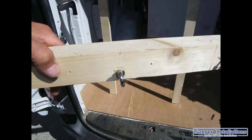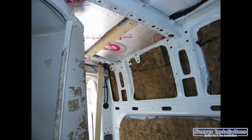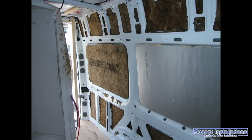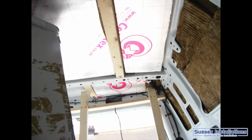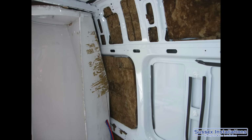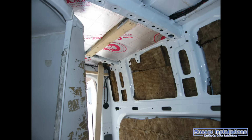And still sticking with some basic preparation works, I really wanted to put a hook in my shower. I windsurf and go surfing, so I want to be able to hang the wetsuits up inside the shower and have them dripping. So I'm doing preparations like putting a piece of timber above the shower, which I would later put a stainless steel hook through, into the piece of timber with a recessed bolt inside the timber to hold the weight of the wetsuits and things hanging up. And again, continue to work on all these small little details before really going ahead. You pull something in, you take it out, you twist something, adjust something, pull it out, pull it in again, and keep on going.